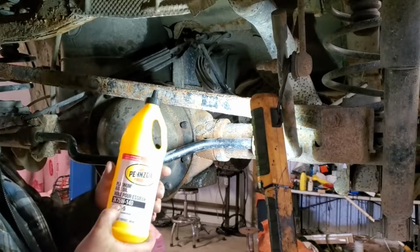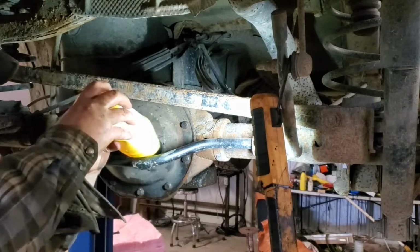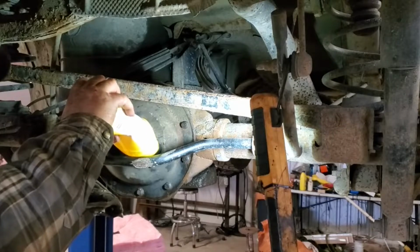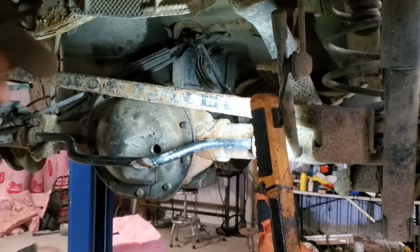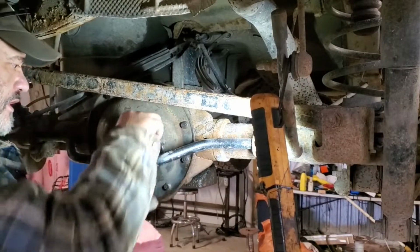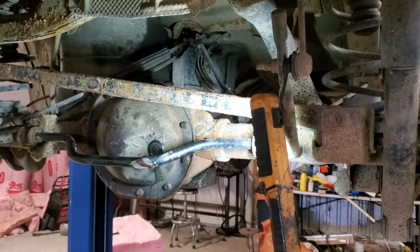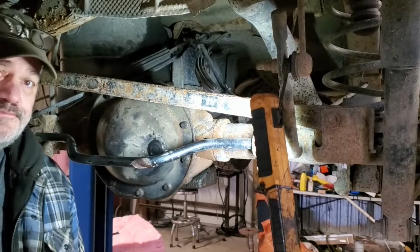All right, 75W-140 for the Nitro rear axle. It's a little cold here, and this stuff's kind of like molasses right now. I had it in the house trying to warm it up. Honest, it was a bottle, not me. Okay, you know you're full when it starts to come out. And just push your little plug in there. I can't believe that what we used to put in for plugs, that's what they put in the 2008 Nitro. Okay, so that's what's involved in changing your axle seal.